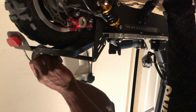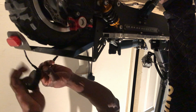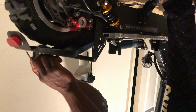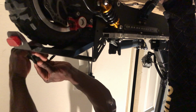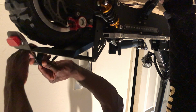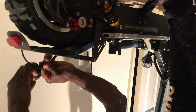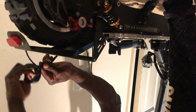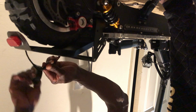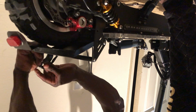So in any case the tire starts maybe touching this cable because of you riding into some bumpy road and the shocks keep working so hard, or for whatever reason, the tire will be grinding on the insulation tape that you're putting on, not the actual wire. So we do it like that. Move all the way, just like that.